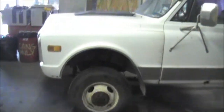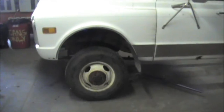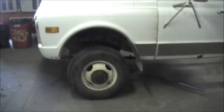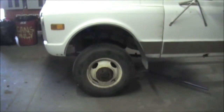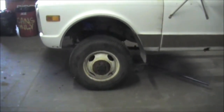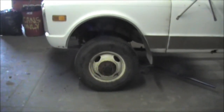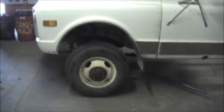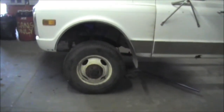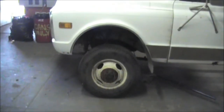As it turns out, my measurements were dead on the money. What's kind of surprising about this is when I built the mounts for the front suspension, the cab and the front clip were sitting 30 miles from where the truck frame was. So all I had was the truck frame to work with — the busted two-wheel drive suspension that's sitting outside now. I didn't even use stock leaf springs, so I couldn't use any stock geometry because I used 73 to 87 springs. As you can see, it looks like that wheel will compress right up into that wheel well really nicely. I'm very happy with that. It wound up about a half to a quarter of an inch back from the stock location, but it should work fine. I don't even think I'll have to trim my fenders at all, hopefully.